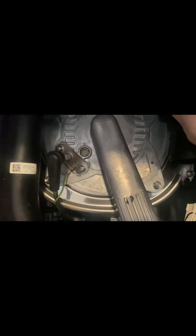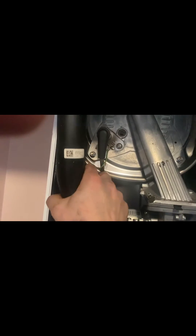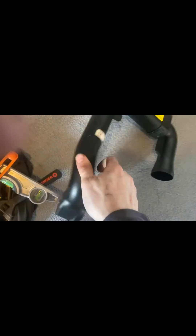The sensor itself is located just behind the snorkel down to the heat exchanger. First thing I do - whip that snorkel off, stick it to one side. That'll give you a bit more room to play with.